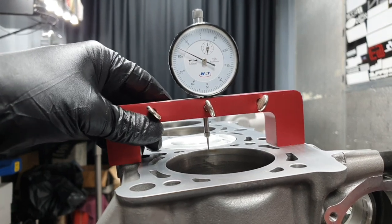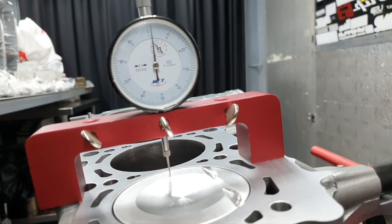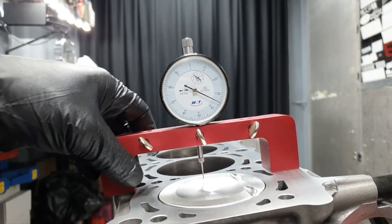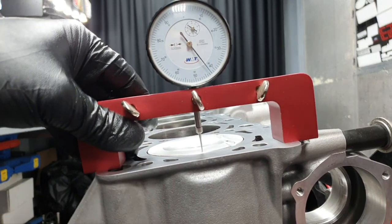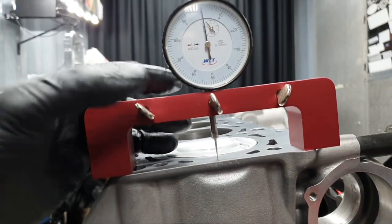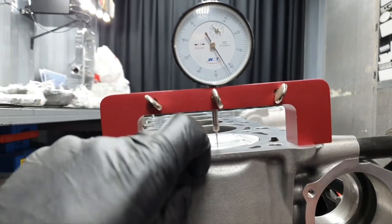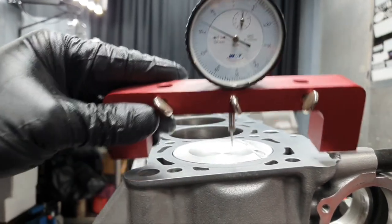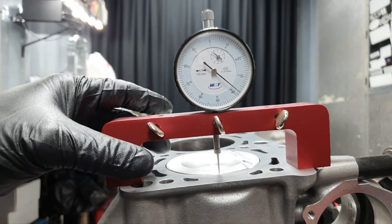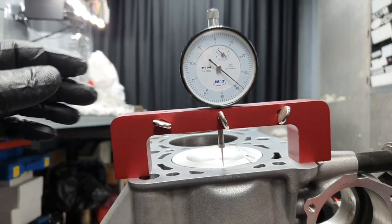Okay, all right. Yeah, a little bit more down. It's 35. This is okay, zero deck, all right. Let's squeeze a little bit down here. Let's see back how much it is. So that means 0.4. Yeah, it's almost 4/10 of a millimeter higher. 38, okay.